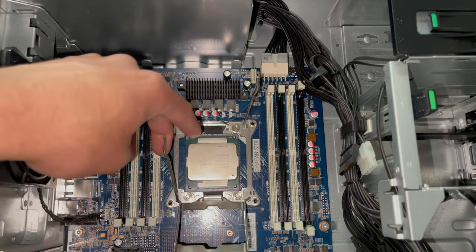And like I said, we're gonna do the X pattern. All right, that should be good enough. Please don't absolutely roast my thermal paste applying. Like I said, this should be just fine. So let's go ahead. Actually, let's add just a little bit more. And that should be just fine. So let's go ahead and clean off the heatsink and reapply it.